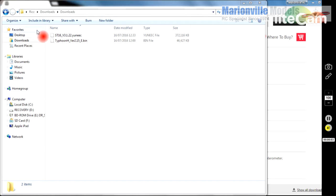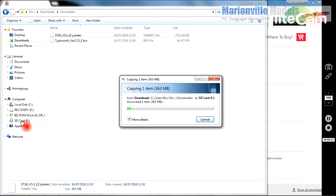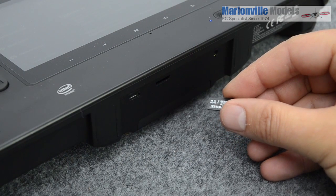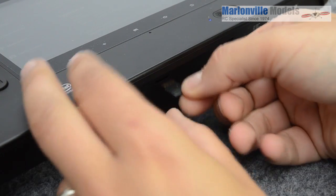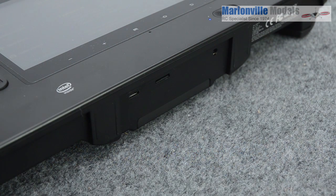Once the bin has been downloaded you will see your firmware downloads appear here. If we're updating the ST16 controller we find it here. It's always worth freshly formatting your card before you start — give that a format, make sure there's nothing important on it. Then it's just a simple case of dragging and dropping the bin file across to the SD card. Now that we've got the firmware onto the SD card we need to install that into the base of the controller — just remember to get it the right way up.